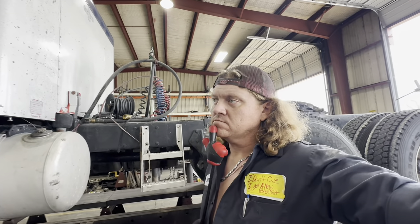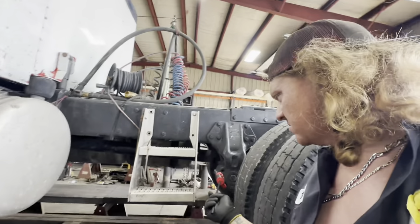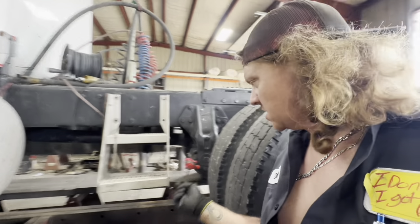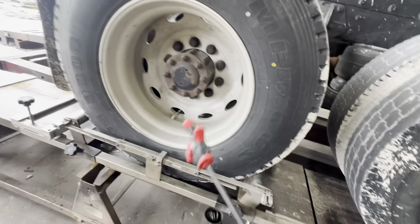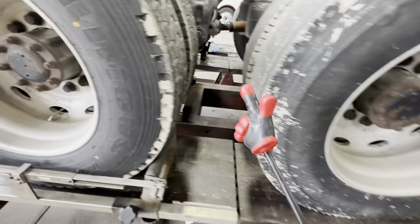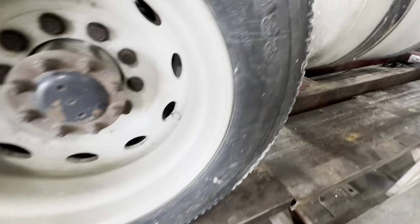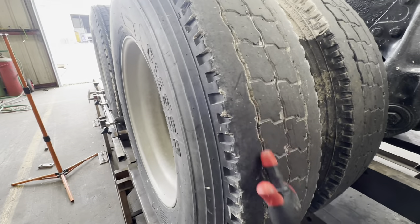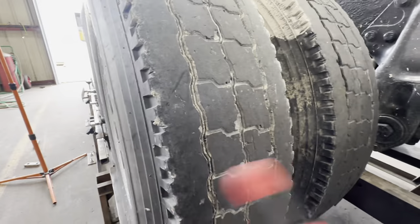So now you ask yourself, which side do we move? Well, that side is further forward than this side. We look — there's a bunch of shims right there. If this measurement is too far apart and your thrust angle is off, your tram angle is going to be off the opposite direction. You're going to go down the road and the back end is going to feel like it's fish-tailing. And you're going to see some serious chop on the inside edge of your tires — it's going to look really weird.